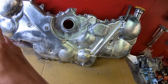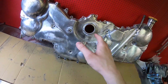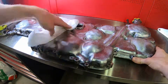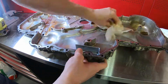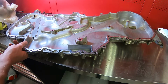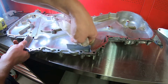Next step, clean it on the inside and a quick rub down on the outside, and degrease the contact patch where the RTV is going to go, and then we will squirt some of said stuff out and bolt it in place. Safe to say, I'm also going to blow this out with compressed air after I've done this. So I know it will be completely spotless.